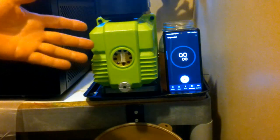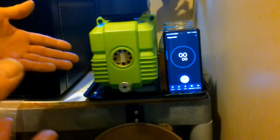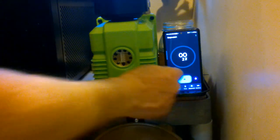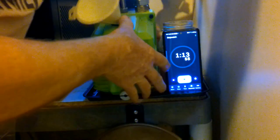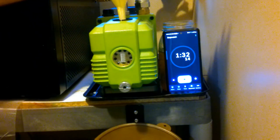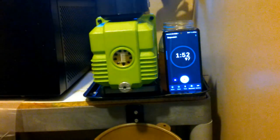If you're concerned about changing oil, that's something you're going to have to get over with. An oil change only takes two or three minutes and it's very simple. Harvest Right recommends changing the oil occasionally; I change the oil after every batch. I just had a batch finish, so this pump is nice and warm. I'm going to tip the pump forward with a block of wood, close the valve, remove the block of wood, and pour in the next batch of oil — all pre-measured. Oil change in less than two minutes. Changing the oil is simple and not complicated.